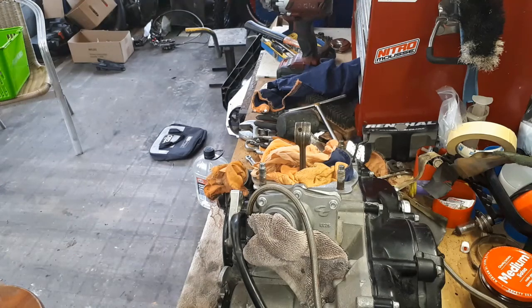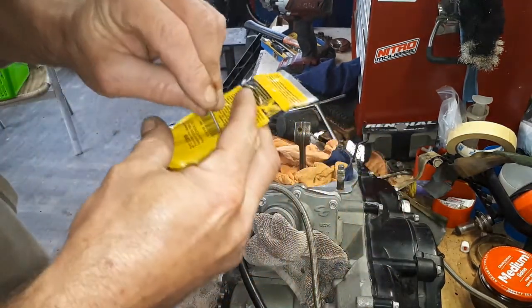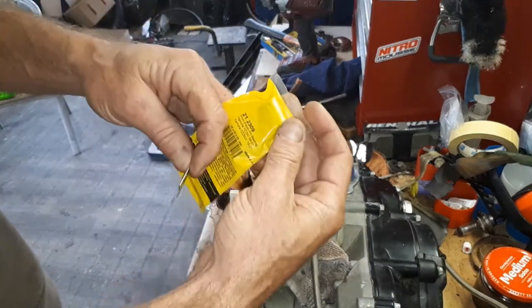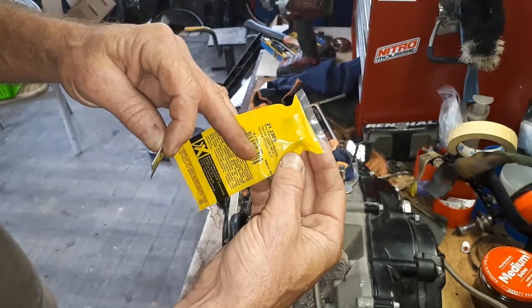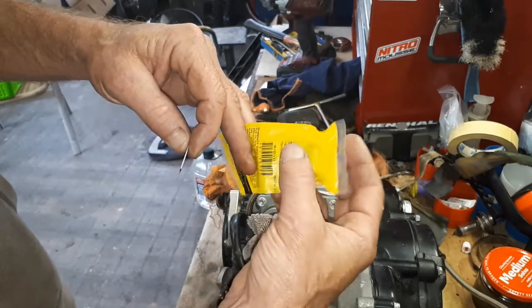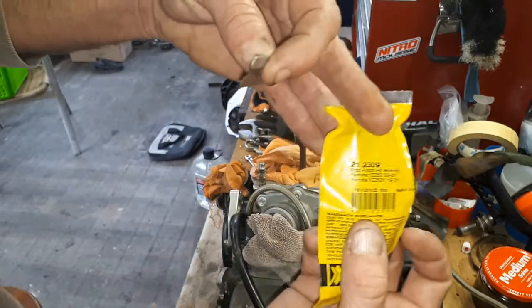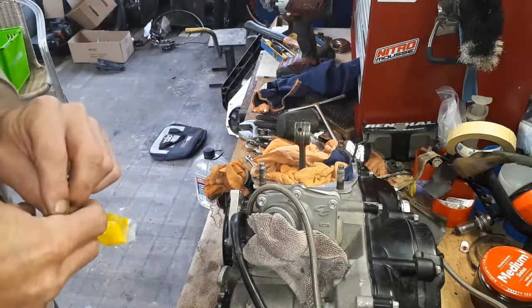That's very important. Okay, little end bearing, always make sure that you use a brand new one of these. For the Gasgas, this is just a Pro X one. It actually fits a YZ250 and a YZ250X. So it's 18 by 22 millimeters by 22 millimeters. Can you see that? There's the part number. Pretty common bearing.